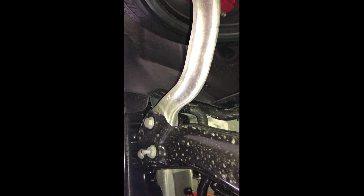If you ever have a brake squeak, take it off regen, find the biggest hill you can, and just run it down the hill — because the brakes aren't being used commonly. That's the one thing with these monster brakes on the Performance: if you're just letting off the gas and normally using regen, they're not getting exercise.